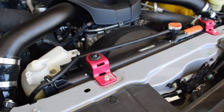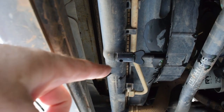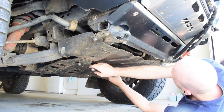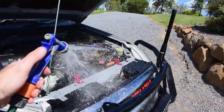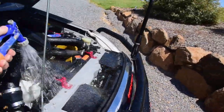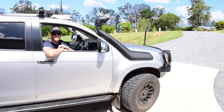I'm keeping my revs up to about two, two and a half thousand RPM and watching the coolant temperature to make sure it gets up to halfway and reaches operating temperature. Now I've got the vehicle up to operating temperature, I'm just going to do a quick check around before we put it back together — make sure the level in the overflow bottle is still on full, make sure the cap is tight and not leaking, and make sure the drain bung underneath is tight and dry. I'll chuck my undertray back on and give the engine bay a quick clean down to remove any coolant residue. Now it's time to go for a decent half-hour drive to let all of that coolant circulate through the system.